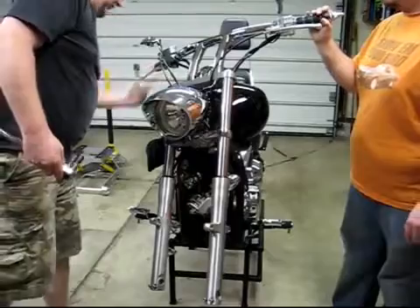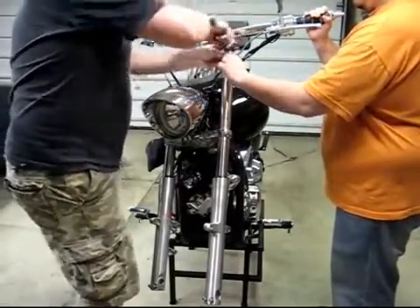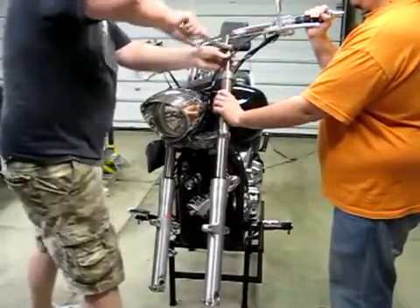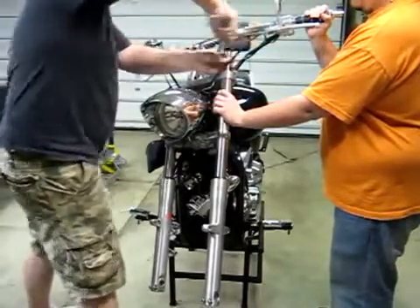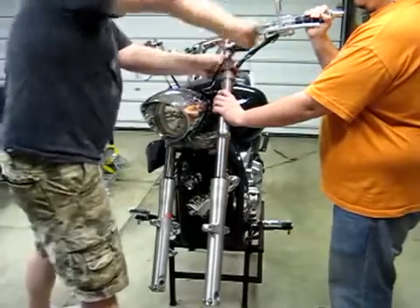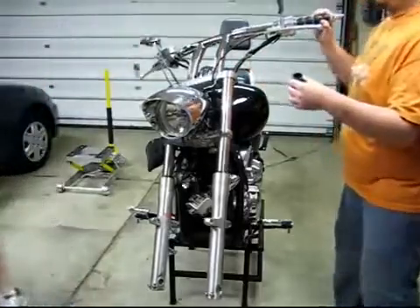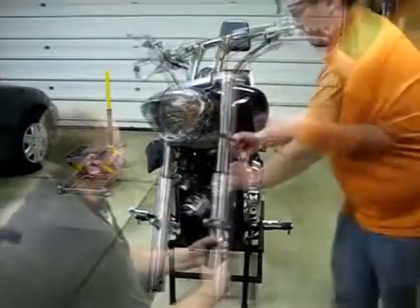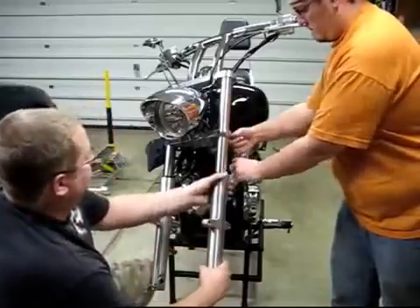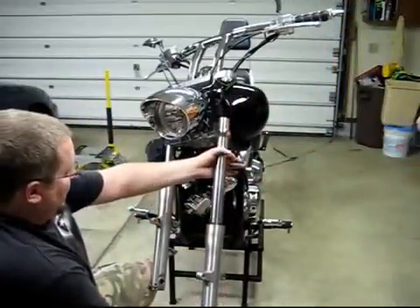Just be careful when we push the lights. Now we've loosened the top and bottom pinch bolts and your fork will slide right out. Be careful — don't tip it over because it's full of oil.